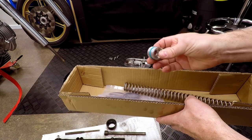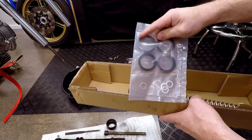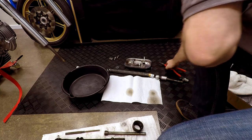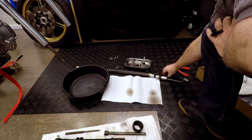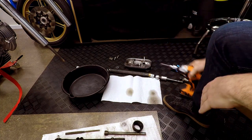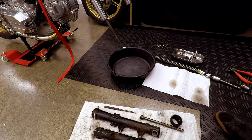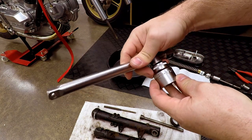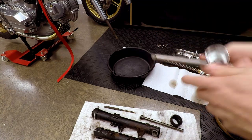There's also some other bits in the kit: a spacer with a piston ring around it — a nylon one — and some extra washers. You're going to need seals for the forks. For tools, I've got these for circlips — there's one outer and one inner to remove. A rattle gun of some sort, just because what you're trying to do is undo. You'll need a socket for the nuts at the top of the fork — this is a nice big one. One and three sixteenths was the best fit for mine; it came straight off.